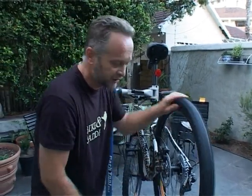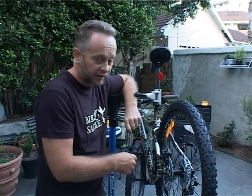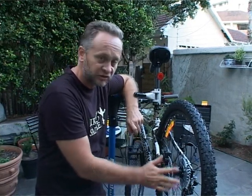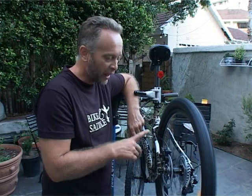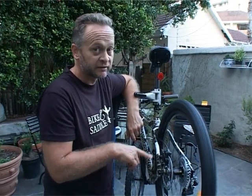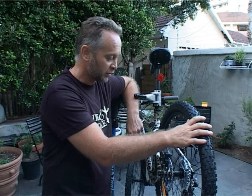When it's not touching and you're happy with the adjustment, give it a good torque on the bolts. Spin it again — perfect, moving freely. Occasionally disc brakes will drag a little — it's natural because of dust or the rotor not being perfectly aligned. Grab the wheel, give it a spin, and count — if it goes around ten times it's running freely enough. If it's less than ten times, redo the adjustment. Repeat the process on the front.